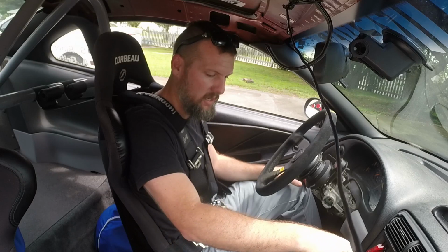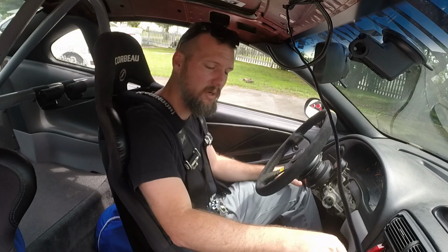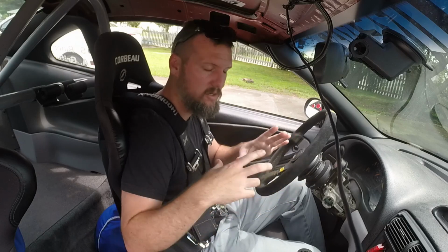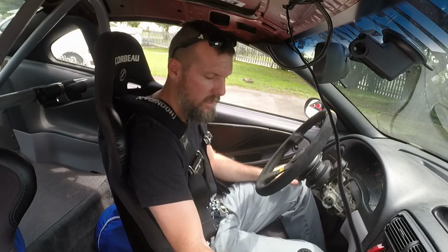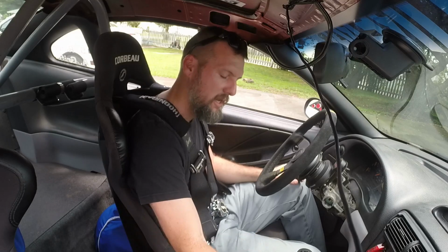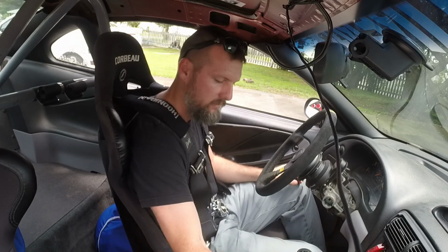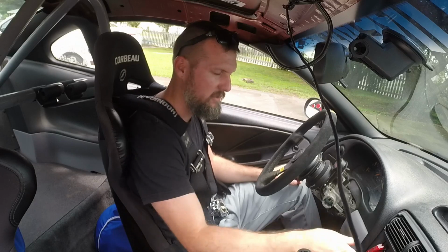Second gear hit a little hard a couple of times, so I might need to look into that. There's still a little bit of alignment that I can do, loosen up the bolts and move the shifter around, but I have all the gears. It popped out of reverse when backing up earlier, so that might also indicate that I need to check the alignment or something like that.